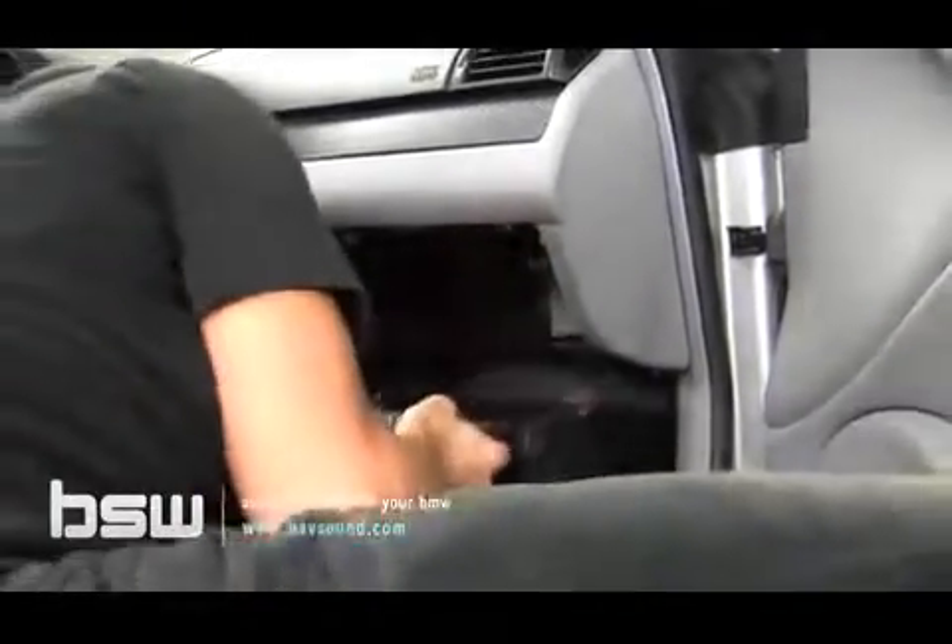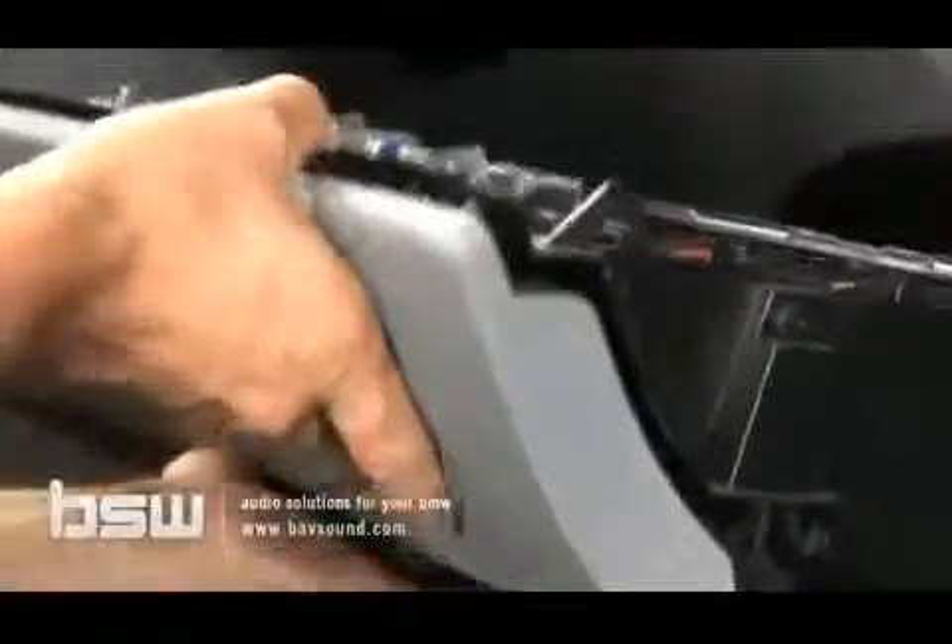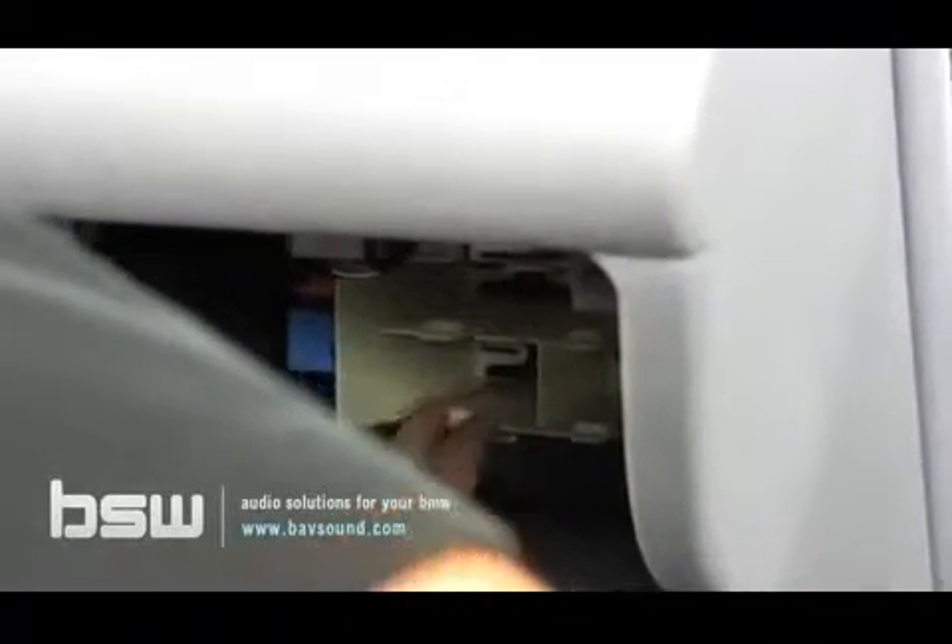To remove the glove box, take your hand - you can see there's a frame that the glove box attaches to. Lift up and it's just going to kind of fall down. There are a couple of little hooks, one here and one here, so you actually lift up and then out - that's how the glove box comes out. When reinstalling, pay attention to that. Let's unplug our light here and again, be very, very careful, it is very hot. Disconnect the light by unplugging it, so we'll have this harness nice and out of the way. With the glove box removed, back here there are all kinds of little slots - this is where our modules are going to live. Your media bridge module, your Sirius module, a standard DICE module, silver line pro, your auxiliary input kit - anything you need, there's plenty of room back here.